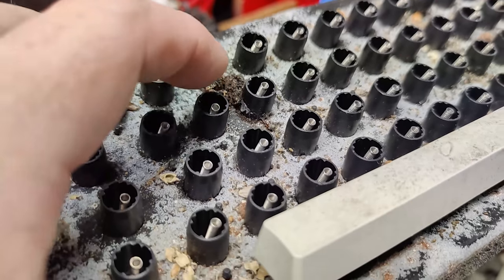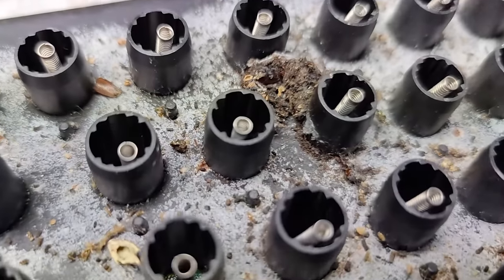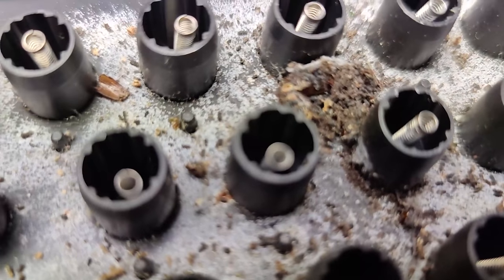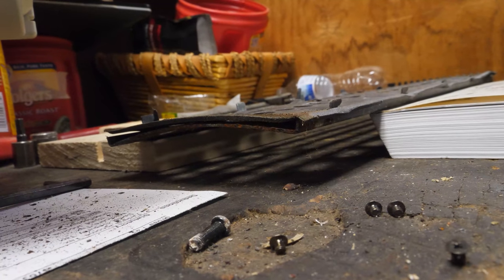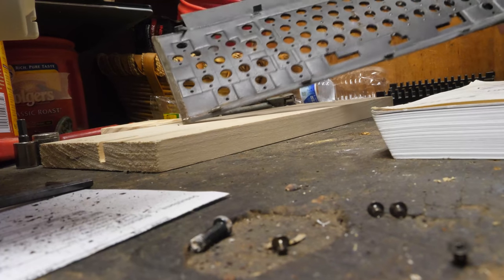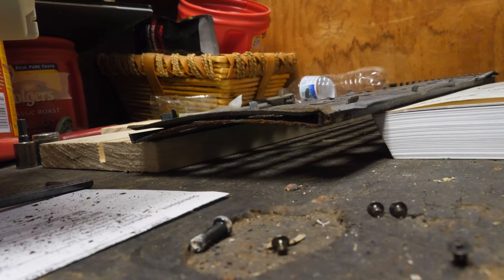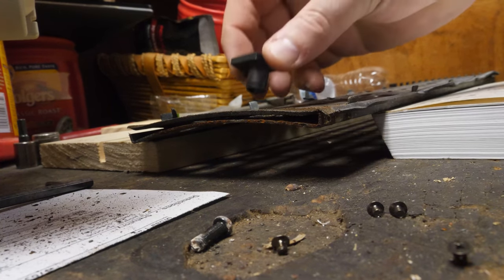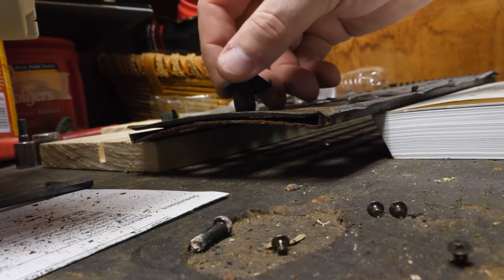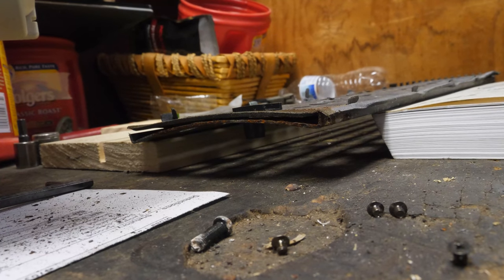When you're doing work on the keyboard and get all the keys off, you've got all these little plastic pegs sticking up and you can't really just lay it down on your work surface. It helps to build up a little support ledge — I like to use a block of wood or a book on the long edges. That'll hold those barrels off of your work surface so there's plenty of clearance. I'm using an IBM mainframe reference manual here, but whatever you've got laying around works just fine.